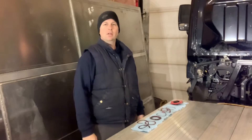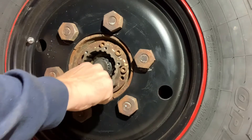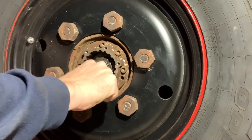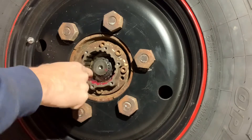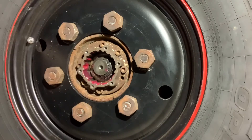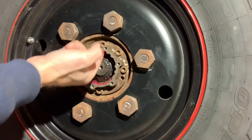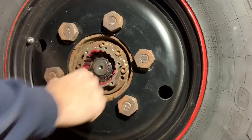Now that all seems pretty straightforward, so how could someone screw it up? Well, trust me, it's not that hard to screw up. Now that everything's been taken apart, I've cleaned it up and I've put my favorite NLGI number one grease on it, so we should be good to put everything back together. Before we start reassembly, you want to take a little smearing of your NLGI number one grease and make sure all the splines in here have a little bit on them — just to lubricate the system going in and out. There may not be very much left from the last time somebody had it apart, or they may not have put any in there at all. We're not trying to fill these voids, we're just trying to lubricate it.